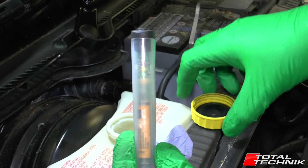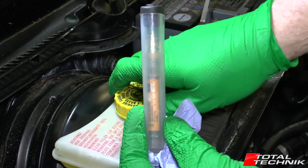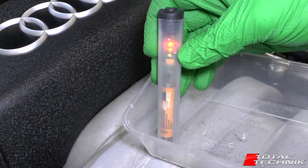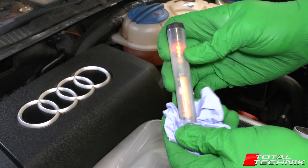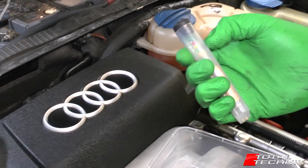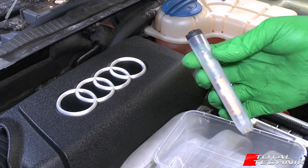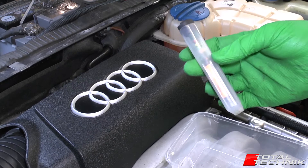I'll clean the tip of that tool and now I'll show you that same test in water, so you can see how it would react if you had too much water in the brake fluid. Here we have just a little bit of ordinary water - repeat the test, comes up with green LED, pop that into the water - immediately red, as you can clearly see. Basically it takes a reading of the amount of water in your brake fluid. If it's up to 1.5 percent you'll get the yellow, which is an acceptable amount. Three percent and above you're going to get the red, which means it's definitely time to change the brake fluid. It's a really handy little DIY tool, well worth keeping at home.